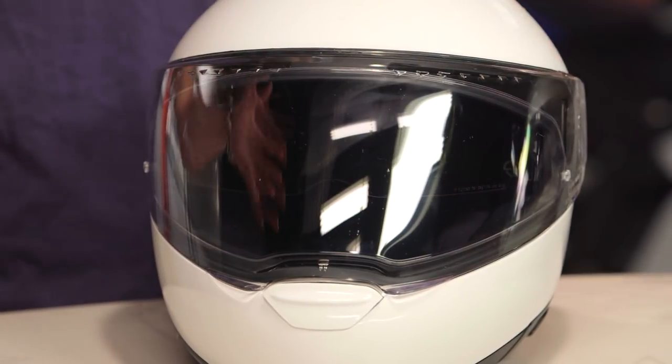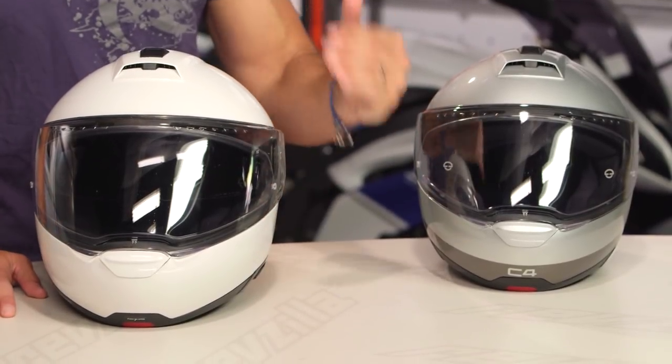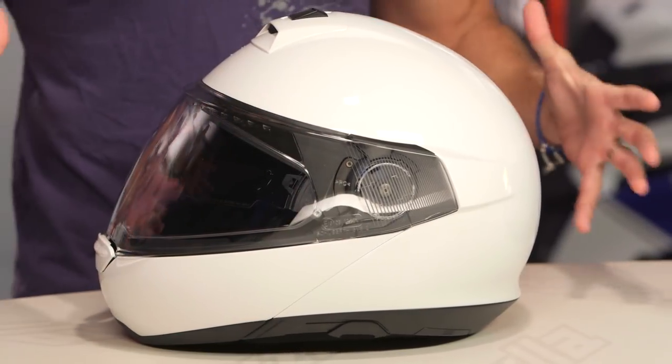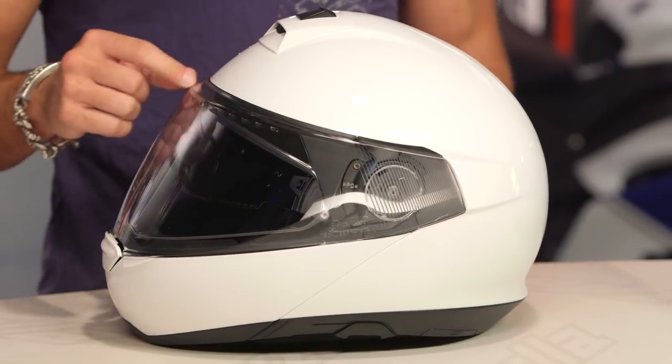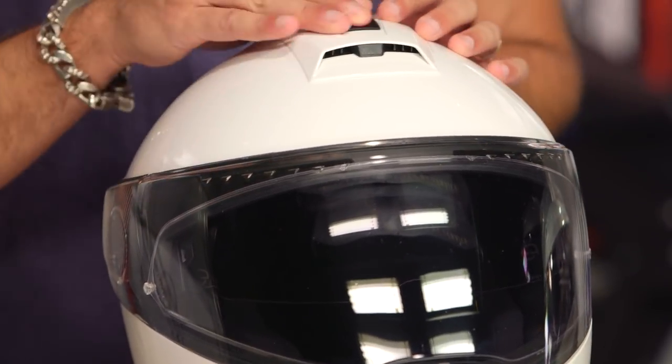While we love this helmet and applaud everything Schuberth has done by way of technology, the reshoot happened when they released the final version with a shell for medium and large that was bigger than originally spec'd, increasing the weight rating. That's the biggest issue to cover, and if you can get past that, it's a phenomenal helmet. Big changes: they've redesigned the shield mechanism — it now sweeps, it's more aerodynamic, it has a great seal, a little more Daft Punk in the styling. It's now fully integrated, accentuating these turbulators that sweep to the side and break up laminar flow — more stable at speed. You also have a ridge towards the bottom and a redefined shell shape. The top vent system has been made lower profile to generate less noise but ultimately functions the same.